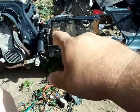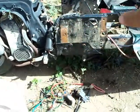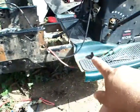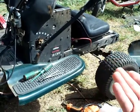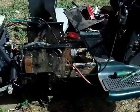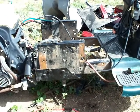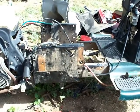But if I build a box frame for the entire thing, you know, up, across, and down, and then run that angle iron all the way down to the front end, having the angle come down and go in, and then put a couple of cross braces inside there, I think that should give me the stability I need so I can make this function. Right now, whew, it is dangerous.